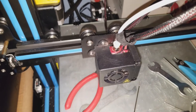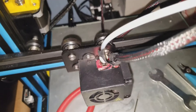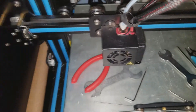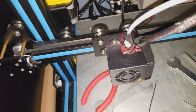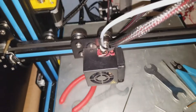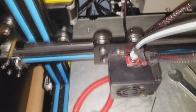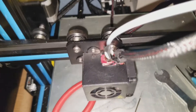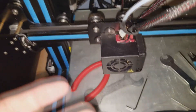Sometimes you can just get away with going up the nozzle and that's it - you're good to go. If it goes all the way in, that means you freed it - very simple. But sometimes it takes a little know-how and you have to take this out. You don't always have to take out the nozzle unless the nozzle itself is messed up. I never needed to take the nozzle out no matter how bad it was, even when friends had overflow floods - I just pushed it out and did the filament trick.